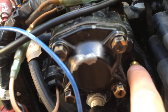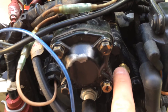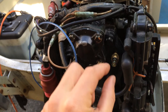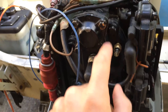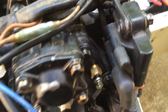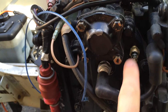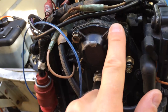If you don't have a blind threaded hole — like these Evinrudes, Johnsons, anything OMC would probably have something similar — you want to mount it high up on the engine somewhere. Sometimes they come with a Z-bracket, which puts the sensor in contact with the head somewhere. You could possibly do it there — see that hole right there? It's another blind hole. Just look around, and if you can't figure it out, have a mechanic do it for you. I wouldn't use a head bolt because they need to be torqued just right and probably need all their threads. Maybe a thermostat bolt.